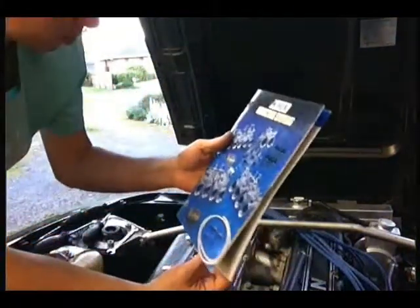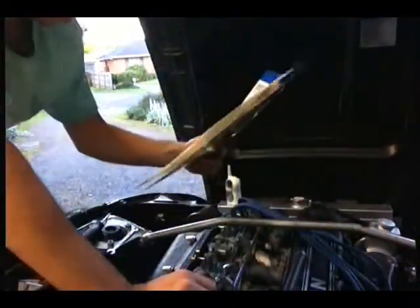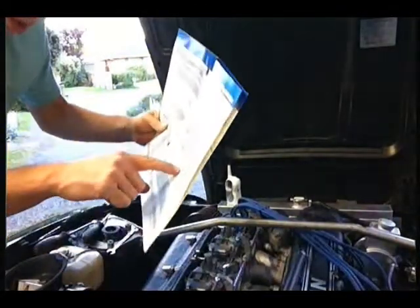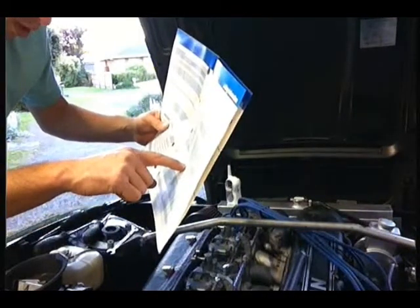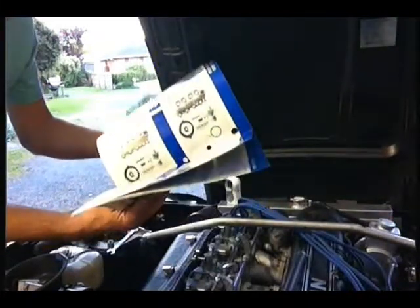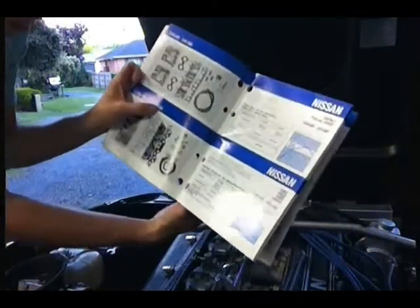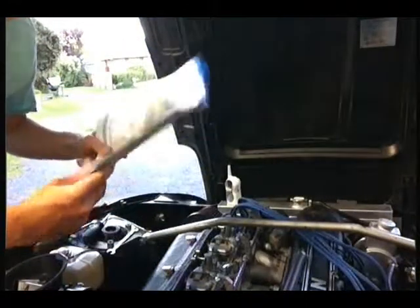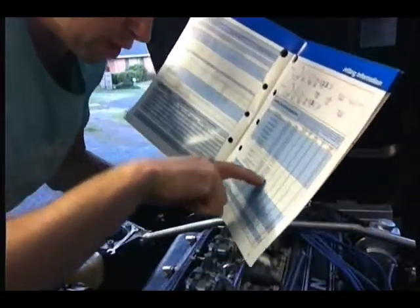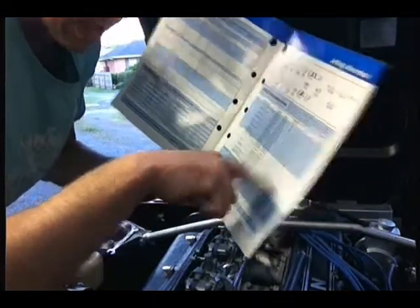So what I've done, I've pulled out the old Mikuni system book. It gives you factory recommendations. I've just had a look through and found a 37 choke being here, oddly enough, for these carbs. It's a set, Nissan Z44550. That's actually what this set I've got in is, purchased from Sam 280Z in America, from Hybrid Z. 37 wants to run 155 mains with a 200 air.